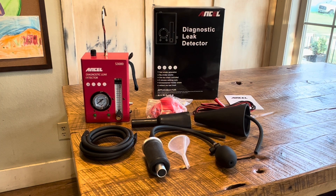We could use this to check for intake system leaks on the intake side of a vehicle. We can also use it to check for exhaust leaks by smoking through the exhaust. Or if you've got a windshield leaking, you could pressurize the inside of a vehicle with it sealed up and then see where the leak is.